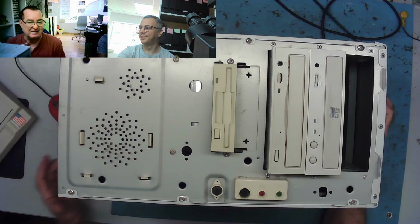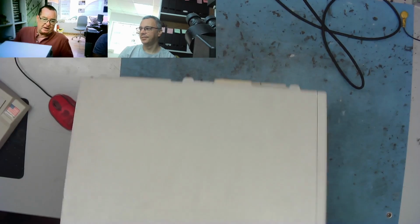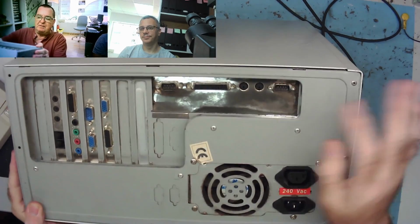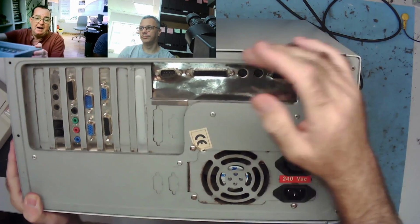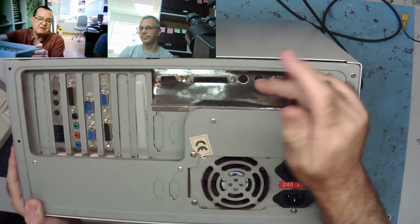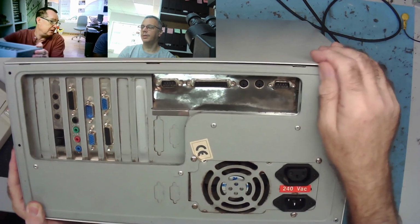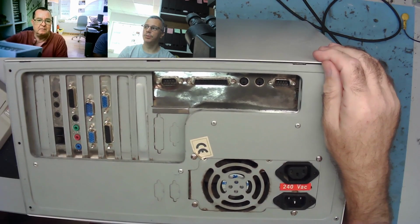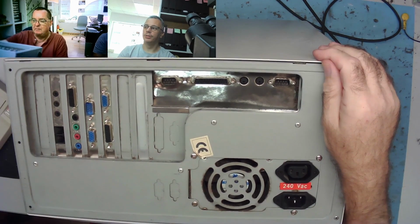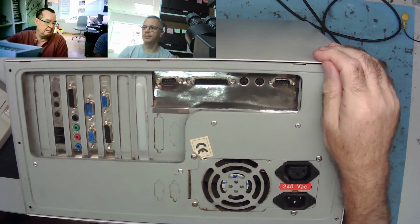Your last thoughts, guys, and then we're going to have the big reveal of what's inside. Carlos and myself have been chatting. My thoughts I put on the end of the last video: it's not an original Pentium 1 because they were AT, and I don't think it's a Pentium 2 because it doesn't have any USB on the ATX motherboard. Carlos, any thoughts? My thought was maybe an early AMD system, but that would be really hard. They had AT variants, and all of them had USB as well. So maybe a Cyrix.